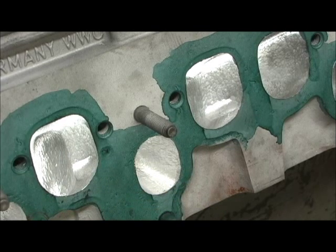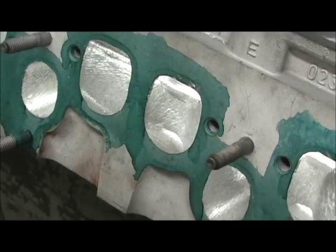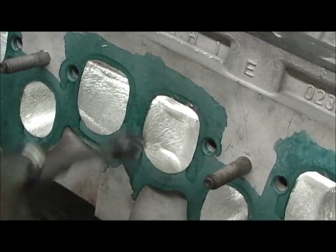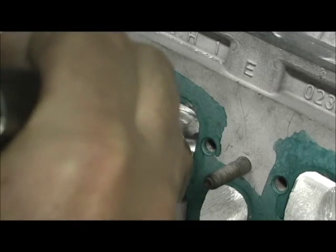That's not what I'm doing. I'm not purposely trying to bust. I'm just trying to straighten that wall out on this head. So I'm going to get the trenches dug on both the top and the bottom. Then we're going to come out for some raw material blending because all the other porting is completely finished on the head. All right, here we go now with the raw material removal, and they're starting to bust through, which I figured it would. I take the big one and start it, I say mainly in the center.